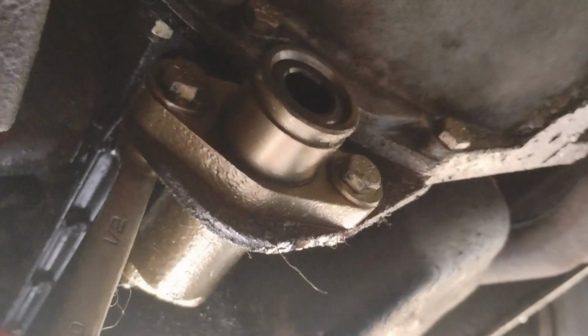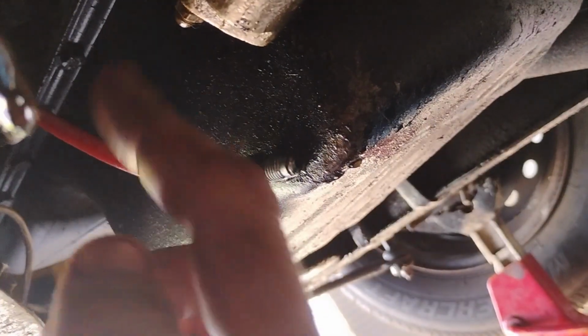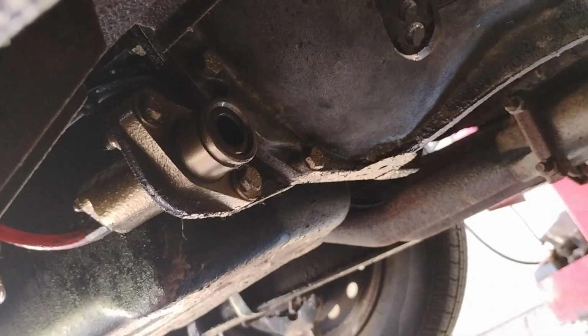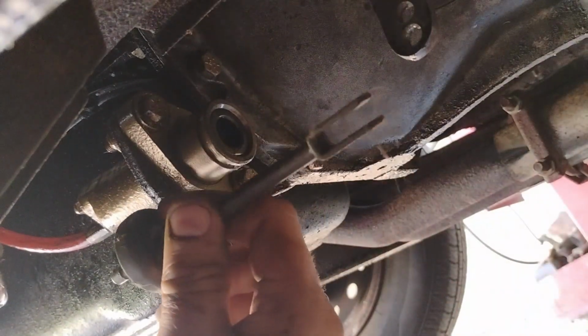New slave cylinder is in there. I tighten it with the impact driver so it's tight. Both bolts. Now I will put some anti-seize on the threads of that line, and then I'll thread the line in. Then we'll re-hook up the rod and clevis pin. The line is on and tight. All the two holding bolts are torqued. We're going to put the rod back on.